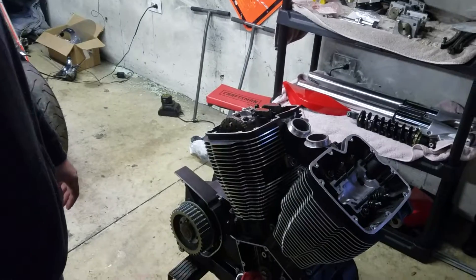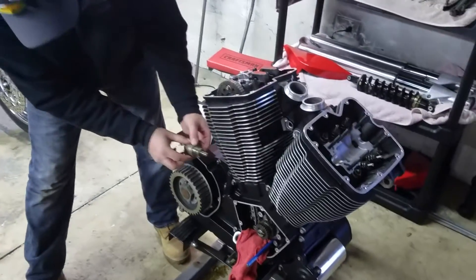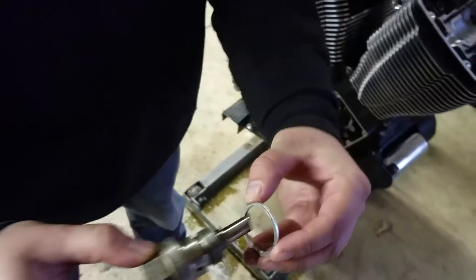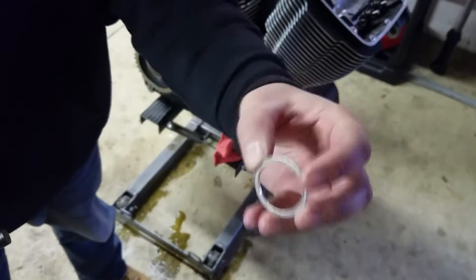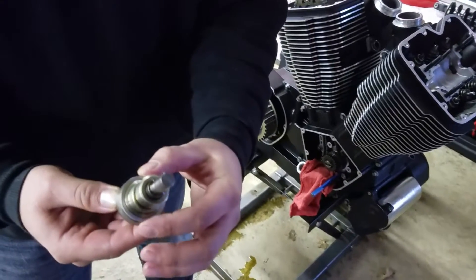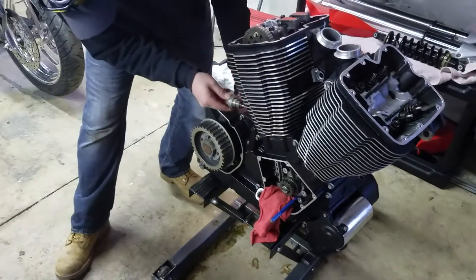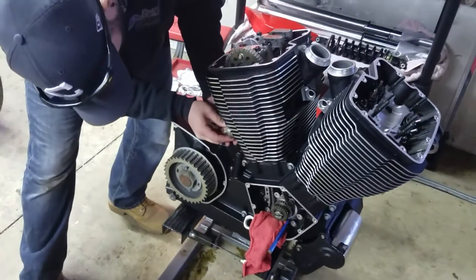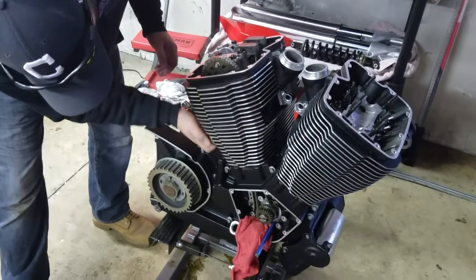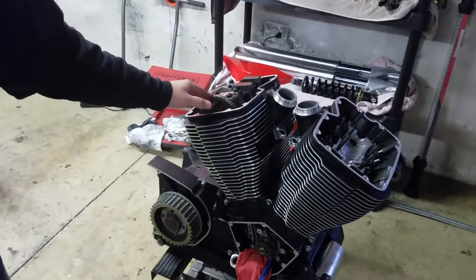You can't go any further with timing this motor until you get to this part. I'm going to slide this in here and get it tightened up. One thing you want to know is when you replace these, Victory tells you to replace this gasket — it's kind of like a crush gasket like you'd use on your oil drain plug. Make sure you replace that. I'm just going to slide it in here and give it a couple turns. You'll actually hear the hydraulics kind of bleed down a bit.